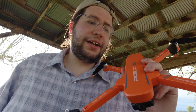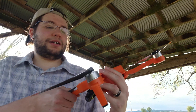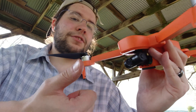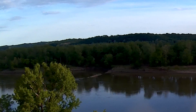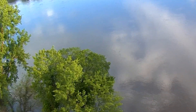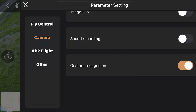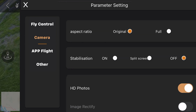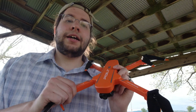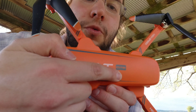You're getting maybe upscaled 1080p or upscaled 720p — you're not going to be making anything cinematic with it. We flew for quite a long time — at least 20 minutes. The gimbal has some shakes and issues, a little bit of jello. Make sure you remove that film on the front of the gimbal or your video will just be rough. You really don't notice some of these issues in the app — it's more obvious on full screen. Also, there are no camera controls — no way to change the EV, no ND filters. It's not a professional product, not meant to be. Just meant to throw in the air, have some fun. And I guess it does that. That's it, guys — let me know if you have any questions about the JJRC X17. I really cannot believe they misspelled the word 'pilot' right across the top. What are you guys doing?